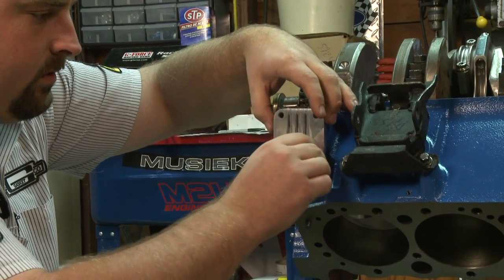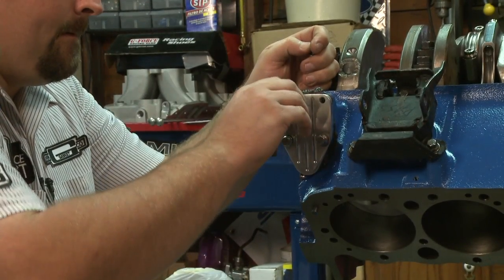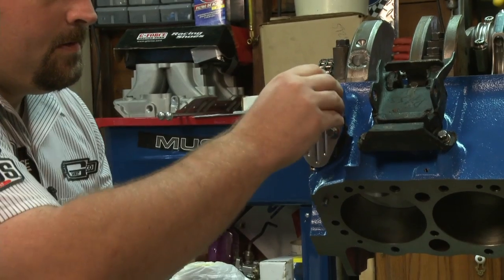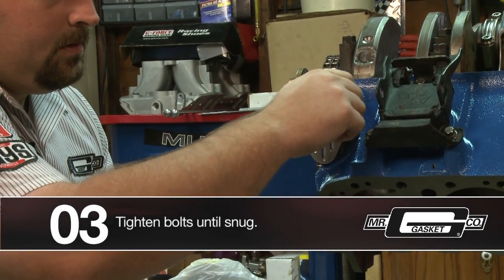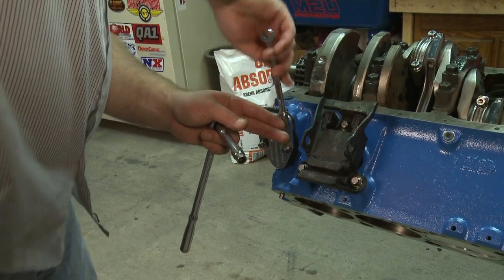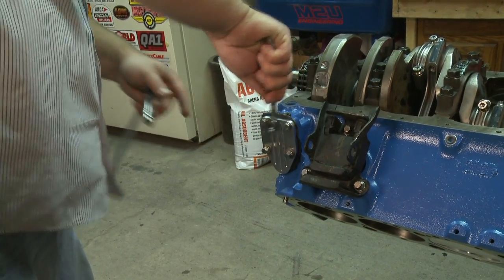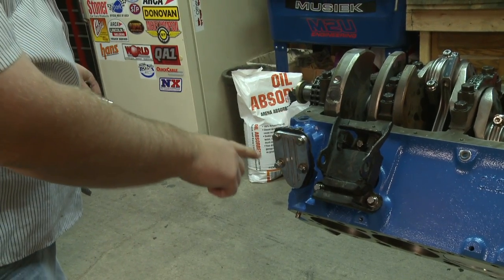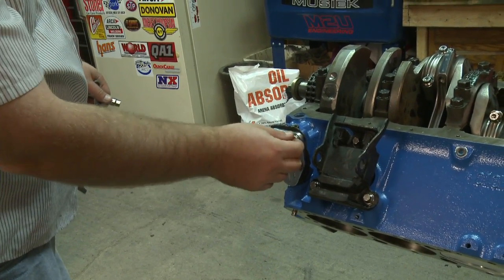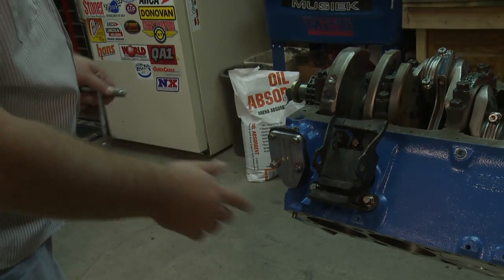Just start your bolts to get you lined up. And then with the extra bead, you can smear it down with your finger — it'll help fill in the gap if you don't have the gasket — or you can wait until it dries and use a razor to simply cut it off real easy.